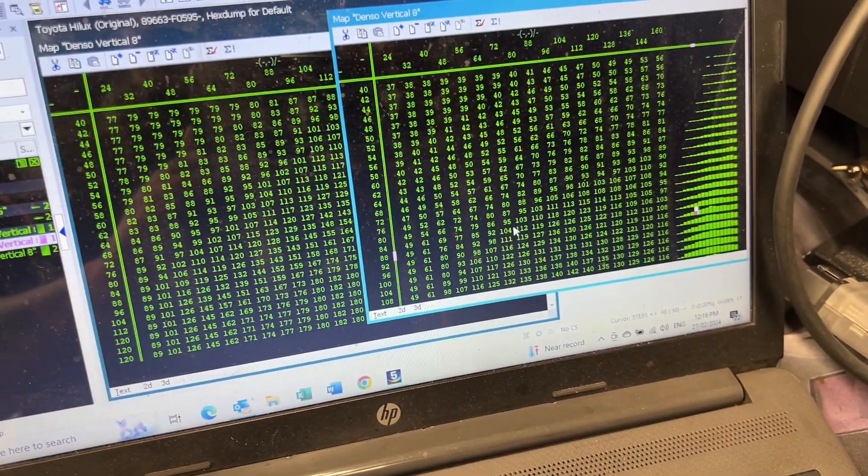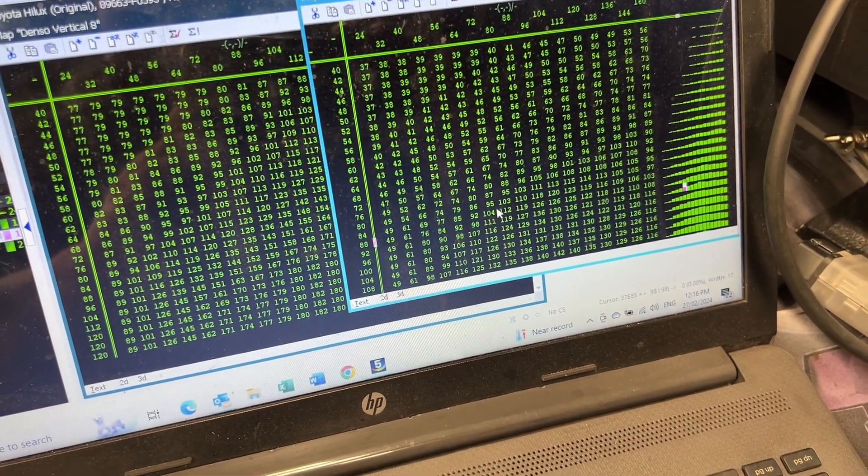So let's wipe this out and start again. I'll probably give it a little bit more boost because it's got good mods — the airbox and the intercooler and the hard pipes. So if we can push the turbo, on these Gen 2s it can go a little bit more than 20 pounds, that'll be okay. We'll take some fuel out of it and I'm also going to do an auto-tune on this one. It won't affect the dyno run but once they drive out of here it'll change the way the car drives completely and save more fuel, because I'll have lock-up in 4, 5 and 6. So let's load this file in, get this going a little bit better. I'll do some playing around with it, make sure we get the boost right, and then I'll show you the end run.